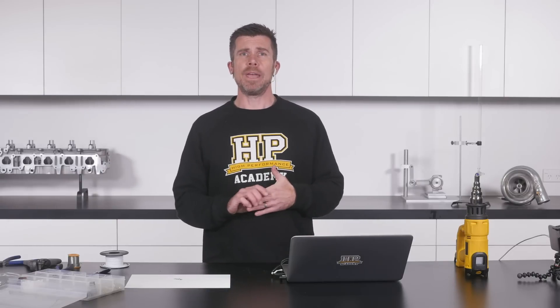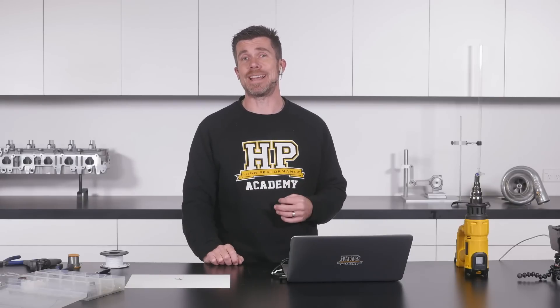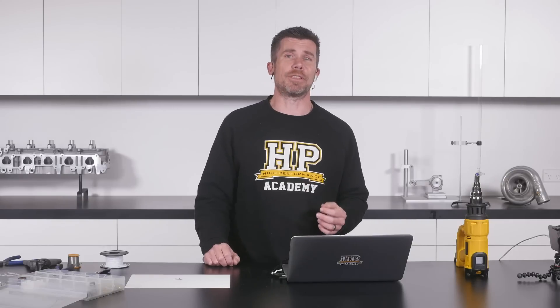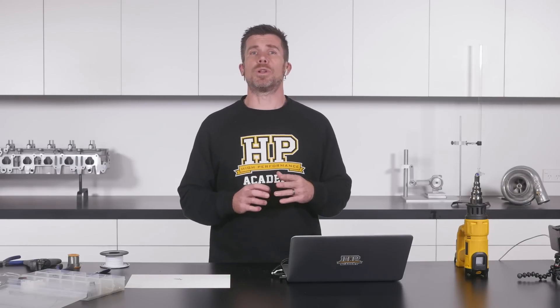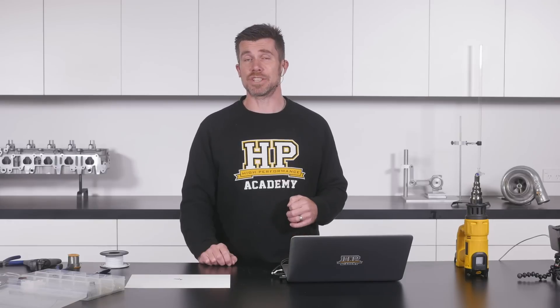Before we get into that, just wanted to cover off a few things happening around here. For those who've been watching the last few weeks, you'll know we are finalizing a few wiring harness design details on our FD-RX7. One of the problems this has highlighted — which is pretty common when making up a custom wiring harness for just about any application — is how do you go about correctly mounting that harness to both the chassis as well as the engine. When you're dealing with a factory wiring harness, this is all thought out by OE engineers who generally have little tabs with plastic grommets and a cable tie that wraps around the harness. Securing that harness properly makes sure it's not going to end up rubbing against engine components and abrading through the sheathing.